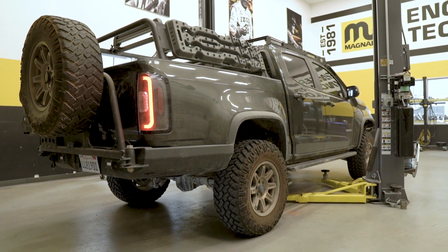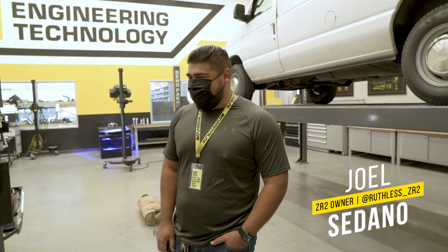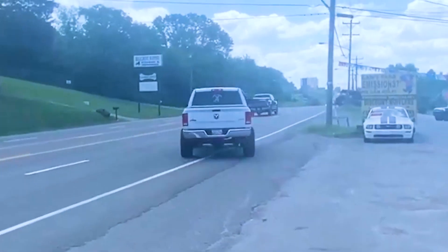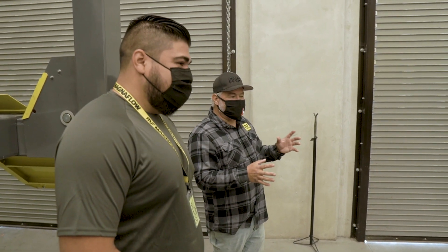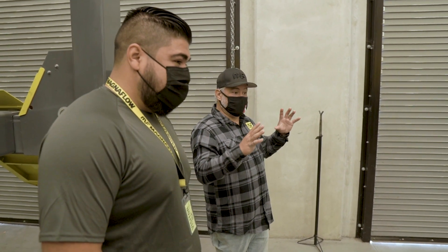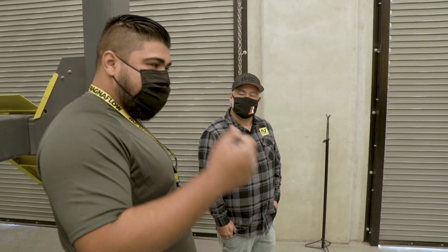I like how it has a little deep note to it, but not overly deep or ricey or crazy. The tune frequency we do inside the pipe gives us the ability to control the mid-range that causes the buzz — no one likes that V6 buzz. So tuning both the internal muffler and the resonance chamber is really giving you a nice performance note without sounding too buzzy.